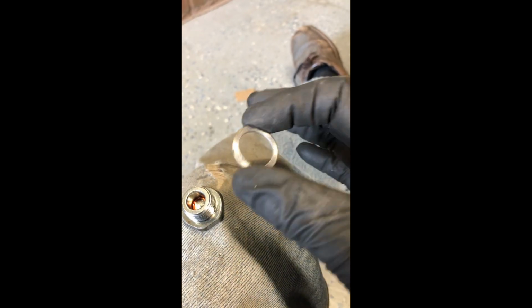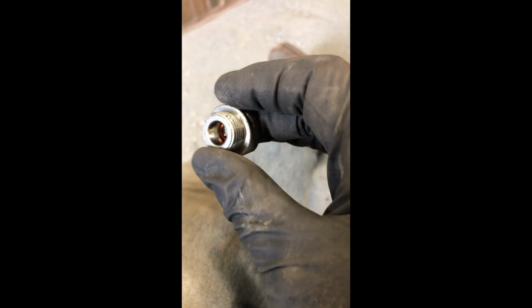And here's the transmission fill plug. So the only way to fill it is from the side, and it does not have a top mount fill plug. So I pulled that out to fill this. This little cover covers that. It's metric. It's a 10 millimeter to get these shield nuts out, and then I used a 15/16 wrench to get the fill plug out. And the fill plug has a copper seal. I have a bag of these. I didn't get one in the filter kit, but I think I've got some of those. So that's how we're going to fill it.